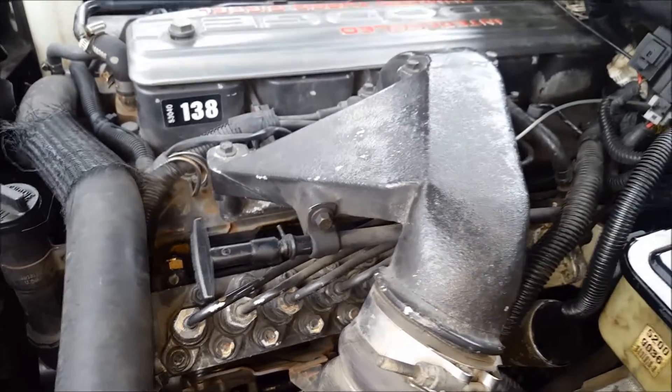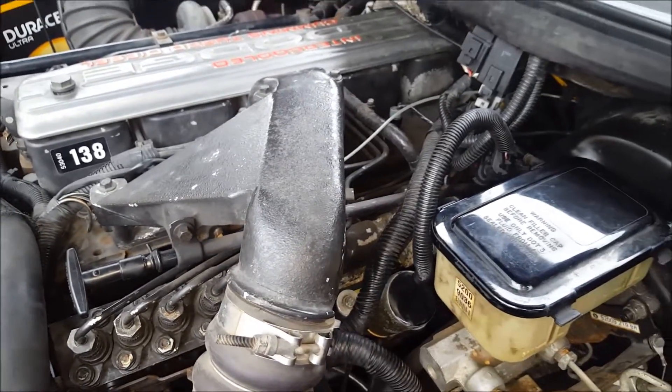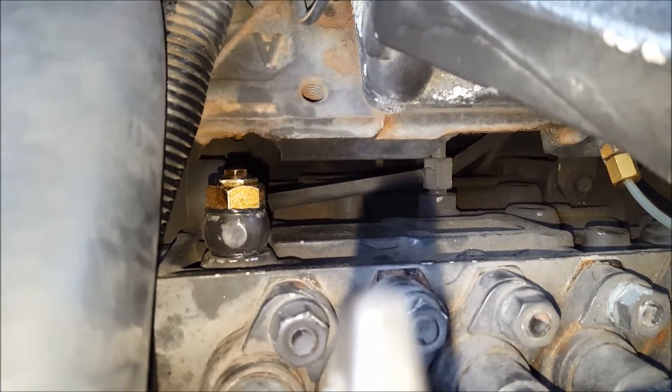When I did that, I had my fuel pressure rise to about 20 PSI. The valve's definitely bad, but I'm thinking maybe the lift pump too. So I got the TorqueTek adjustable overflow valve — it comes with new washers and everything, and I'll put a link in there if you want to buy that.